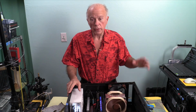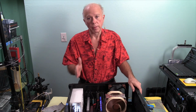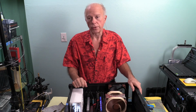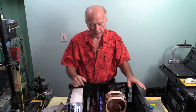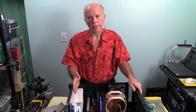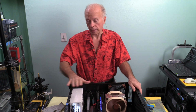And to go to a bigger power supply, my point is, it's not overkill to put in a power supply of about 1,000 watts, because we have a lot of stuff we're putting in. Yes, we still have spinning drives, archive drives, storage drives. We've done a video on that, so I won't get into that. But with all the stuff that's going on in here, you've got that surge to bring the system up and running. I want plenty of power on that machine, because it's only going to use what it's going to need, but I want to make sure there's enough power to handle the platform.